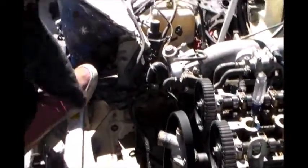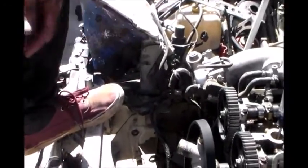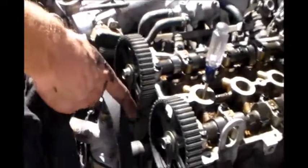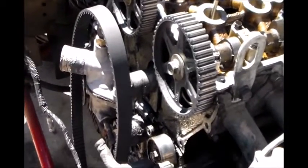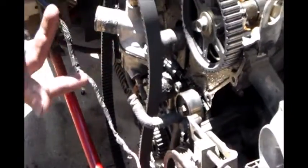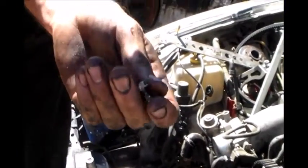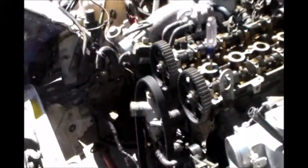So how did that other one break, Josh? When I took off the bottom housing and all that I found this was the culprit. There's a bolt down there that's all chewed up — it got twisted. I noticed there are a few missing ones, so whoever did the last job on the motor didn't tighten them tight enough, so it fell down and just ripped the belt in half. It's kind of random that the belt would break at all. They really don't break — I've had 10 Miatas and never had one break. They usually just get worn out and skip teeth after like 200,000 miles. They don't actually break. So when it broke I was like, that's very strange.